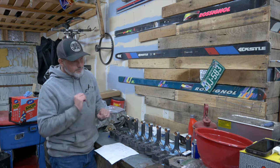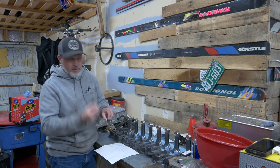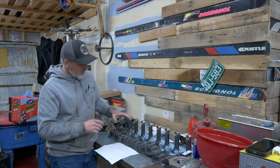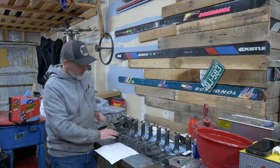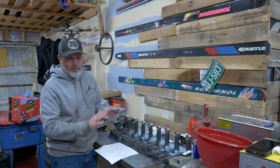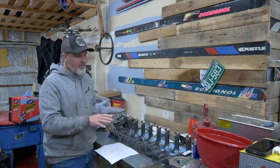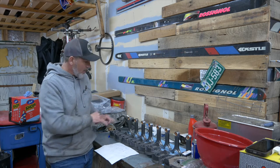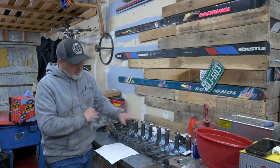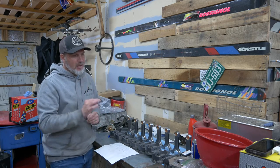So what I did was I weighed the top and bottom of the rod. I also weighed each rod bolt — to give you an idea of what extent I went to — and put it all on a spreadsheet. I weighed every piston, every ring, and all of the clips, which were perfectly in sync. None of them were out of any tolerance; they were all one and a half grams each. Then I matched them up to where each piston kit is less than one gram from lowest to highest.